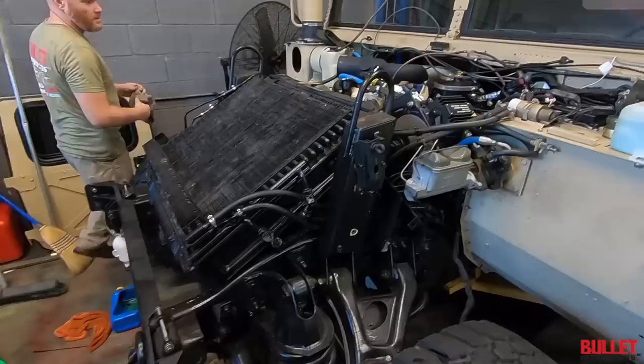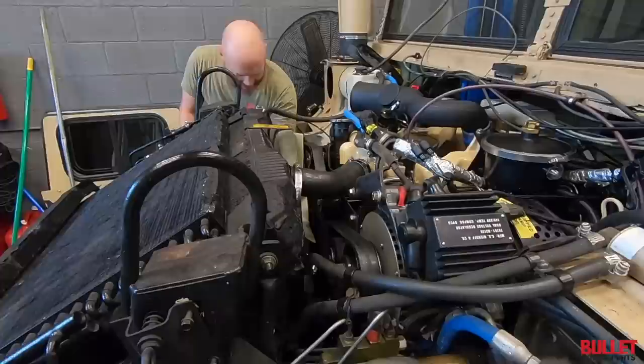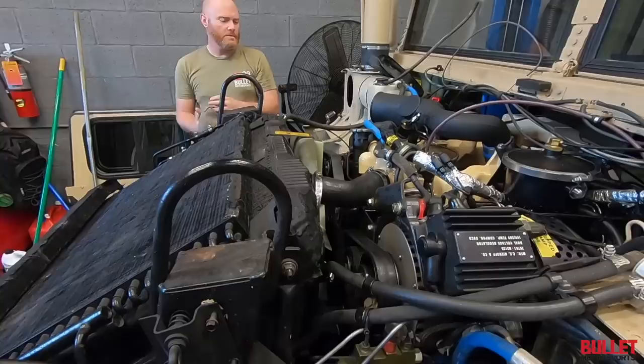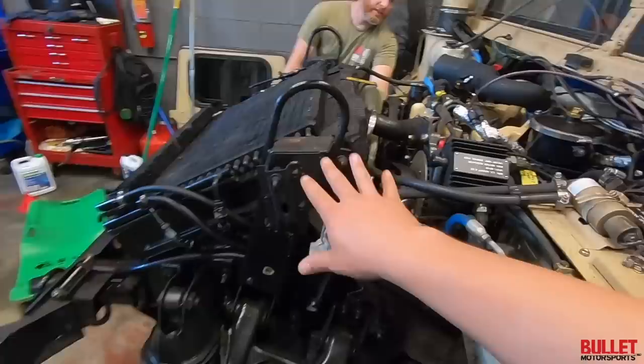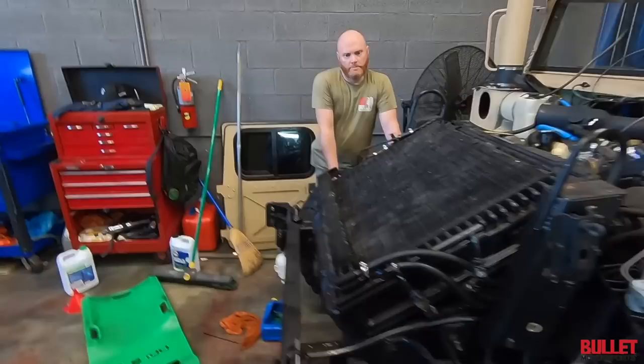So this is going to come off, and that's going to come off, and then we're going to transpose it onto this. Yeah, that fan clutch was noisy because there's a washer on our idler pulley. Tensioner pulley, causing it, when you had it plugged in, to come close to it, and it would just barely tap it every once in a while because the blades are moving. So we took this bad boy off 3 times. Well, Jake took it off 3 times. I just walked 2 times. Well, it's been off 4 times since we built it.